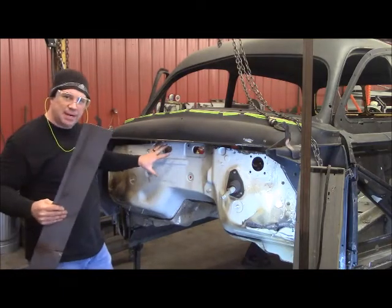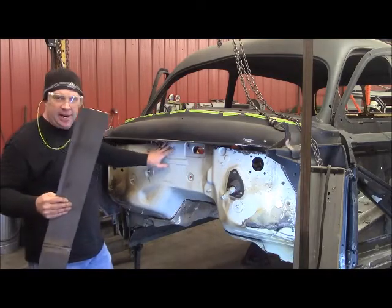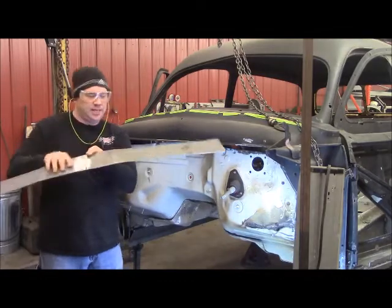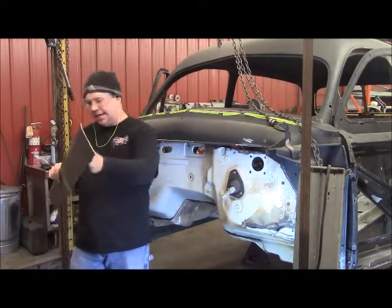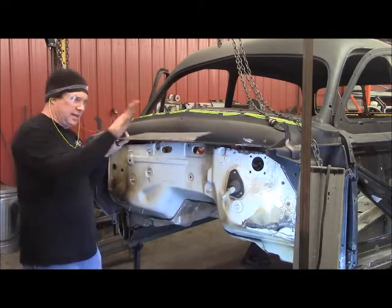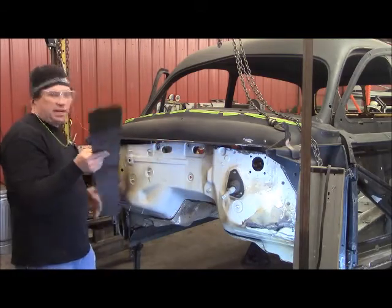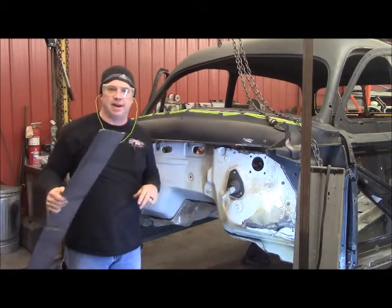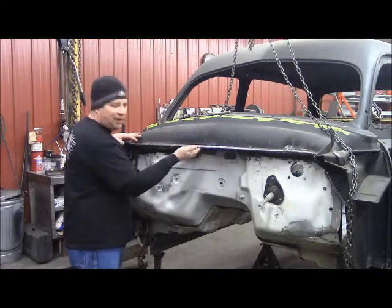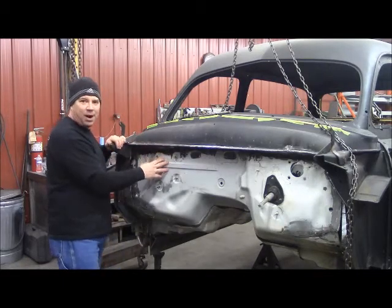Your air conditioner unit is right in the middle and I have to have it up higher in the middle where the air conditioner went. So it's going to make me have to stretch a little on this side and stretch a little on this side. I've got the bend in it here and the bend in here, and I just keep working this down, rolling these corners down on each side. If I can make this fit in there and tack weld right in place, that's going to be huge — that's going to be about the most difficult piece I've got to make here. I've got this piece made — the most difficult piece — done with one piece straight for the pinch weld, stretched and formed and rolled right into the firewall of the Explorer.